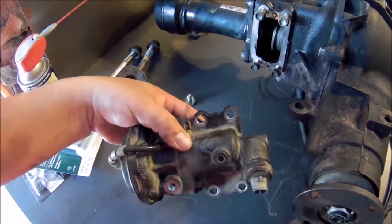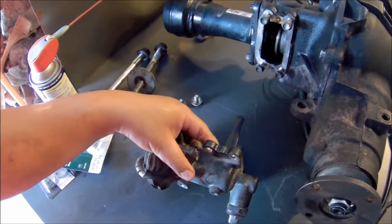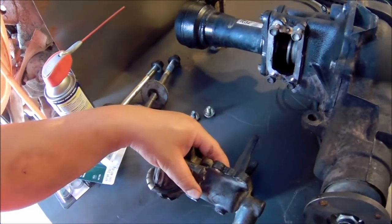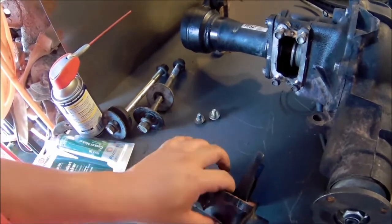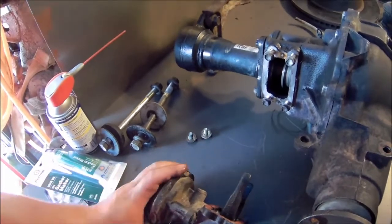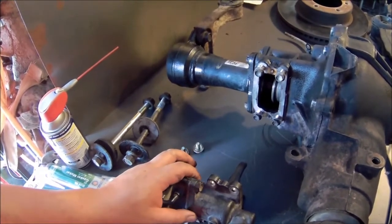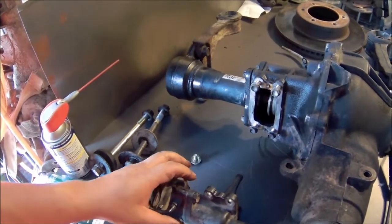If you have manually locking hubs, you can just unlock your hubs and your wheels are free spinning. But if you're like me and don't have locking hubs, your wheels will always be locked in and always be dragged on the front diff, which is perfectly fine. That just means you'll have to make sure to change out the differential fluid with your regular rear and center diff changes.